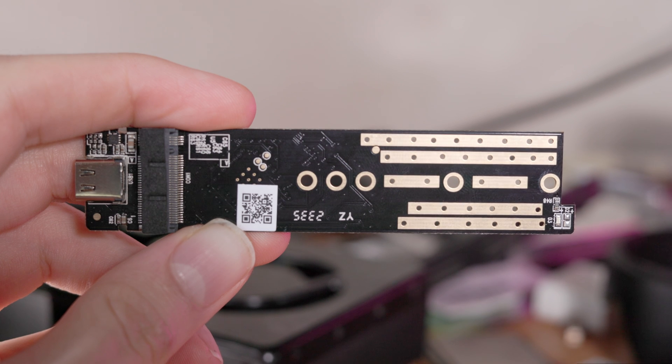Taking out the screw allows me to remove the M.2 drive, and now I can see the converter board and the separate drive. One great thing with this converter board is it works with essentially any NVMe SSD I've tried. I can just plug in the SSD I want, screw it down, and it works with any third-party SSD. It also doesn't add any extra data, so the drive shows the exact same data as if it were plugged into an internal NVMe slot — making it great for cloning or data recovery from, say, a dead laptop.